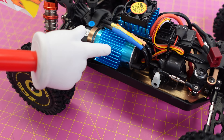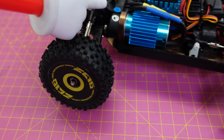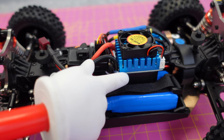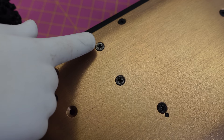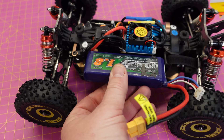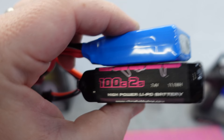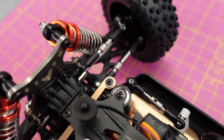Underneath we've got a 4300KV brushless motor — that's what these have in them — and the gearing's the same, but I can't see it on the motor. Little mini three-wire servo under there, separate receiver and ESC on this one — it's a 60-amp ESC. Little battery pack there; it should run 3S but comes with a 2S lipo, 1500 milliamp hour. It comes with a metal chassis. These screws are your battery tray and there are two holes here so you can extend the tray to fit a slightly bigger battery — you should be able to fit a 3S lipo or a longer 2S. We'll run the stock one today. I'll probably do a speed run with my CNHL as well — this is like a little turbo boost. Both are 1500 milliamp hour; the CNHL is 100C and may give us a little boost of speed on 2S.